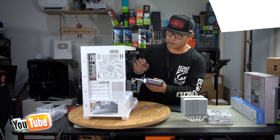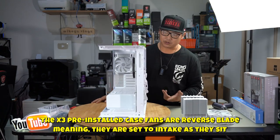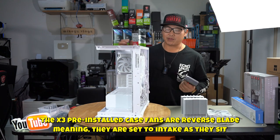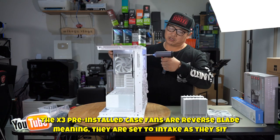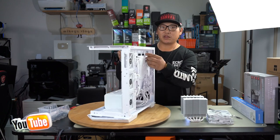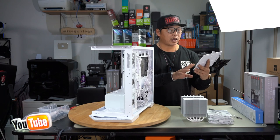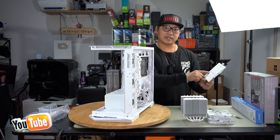And for the lucky last screw. And now your motherboard is ready to go. We're going to go ahead and install our CPU cooler. Now, the reason why I didn't install it off the motherboard, which would have been easier, is simply because you don't have to. I'm going to remove this HDD SSD bracket by removing this thumb screw right here, and then simply lift, slide out. On this here, you're able to install either one HDD or two 2.5 inch SSDs.